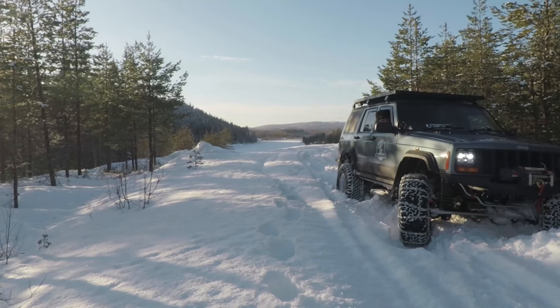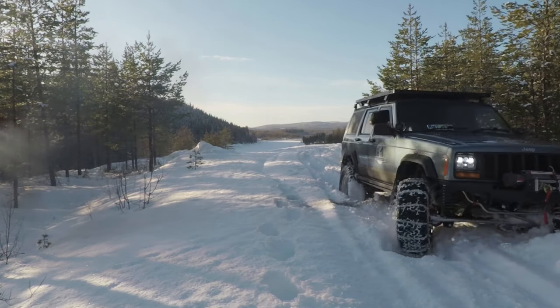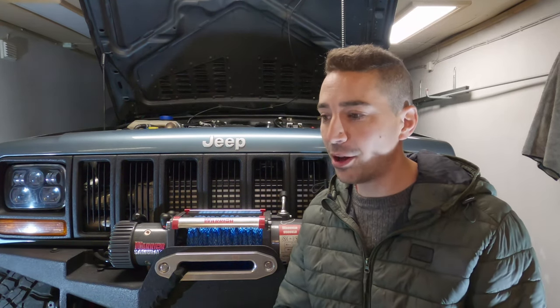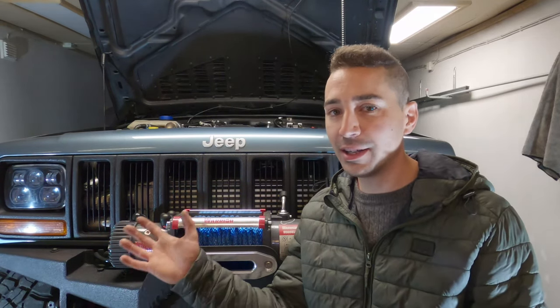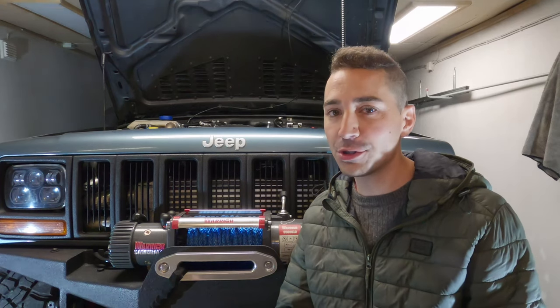power. Now, my engine used to pump out tons of black smoke on the old turbo when I used to go out off-roading. It was always spewing out black smoke. And when I put that turbo on, it was burning a lot cleaner and I had a lot more power. So instantly that tells me that obviously that black smoke is unburnt fuel. That tells me that I'm now getting better atomization of the fuel in the combustion chamber, therefore generating more power. Probably not a lot more, maybe around 20 horsepower, maybe just 10, I don't know, I don't have a dyno. But I could feel a significant change in power.